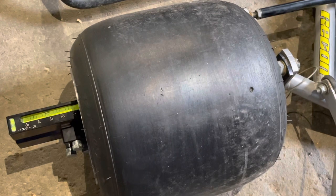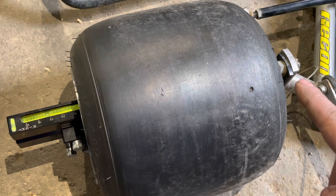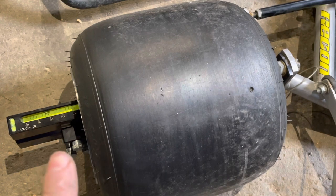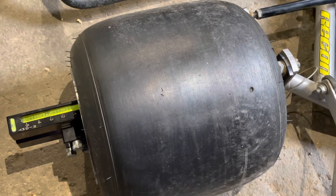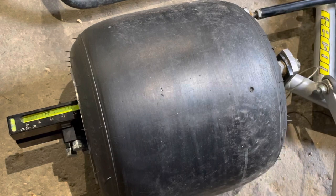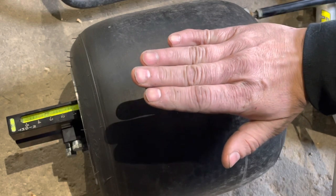Okay, this is my up-close shot. I'm going to get my finger in there — right here, this is where you're going to be making your adjustment on the cart chassis. This is your upper heim on your right front. Over here, this is what we're looking for. When I make an adjustment on the other side in or out, this is going to adjust this bubble. We're going to try and take it to about the two and a half mark. As the tire is sitting here, it's tipped like this — we have too much negative camber in it right now.